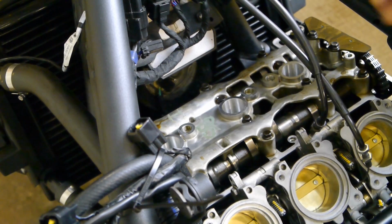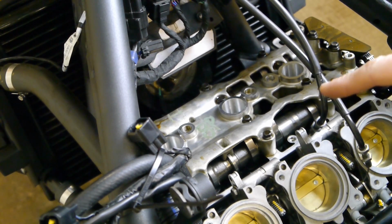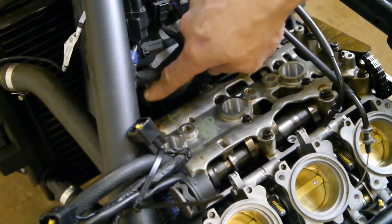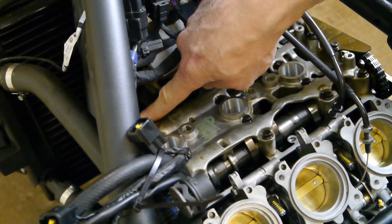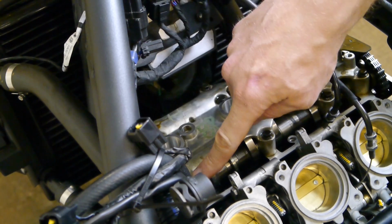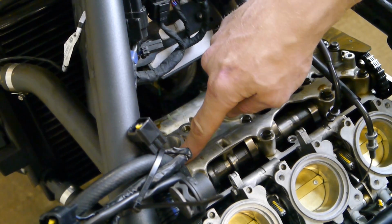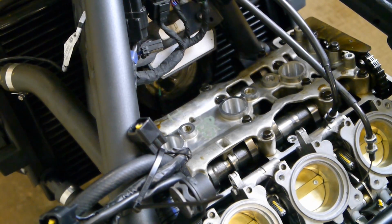Right, so now to take off the ladder plate. There's 16 screws keeping it on. You want to take those off in sequence too. Start on the left hand side with the two outside ones. So it's 1, 2, 2 inside ones, 3, 4. Opposite side. It's 5, 6, 7, 8.